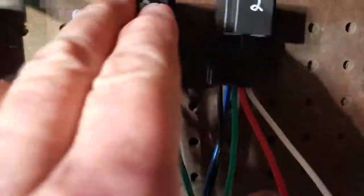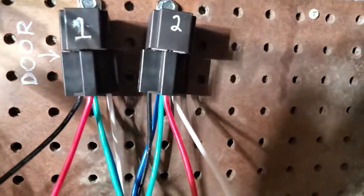I'll put it on pause, put some crimps on, make these look nice, get them all set up for a future tech. I have to put some fuses in here — blue for 15 amps. The main fuse in the coach, in that closet in there, is a 20 amp, so I'm going to lower this one a little bit. I've got to let the dog out because she's barking — hold on.